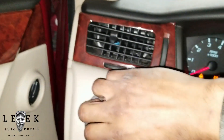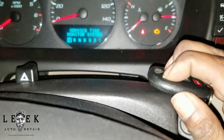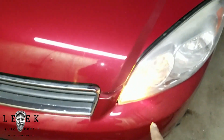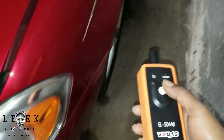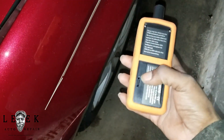Key on engine off — I'm going to turn my lights off so I don't kill my battery. Hold both the lock and unlock buttons simultaneously and wait until it shows on the display. When it beeps, grab the tool. You'll notice on each tire light there's a marker indicator — the orange or amber ones on the front. The brighter illuminated one tells you which tire to start from. We're going to start from the left front, and every time you learn one, the light moves to the next wheel.